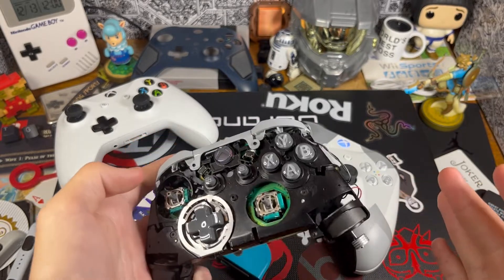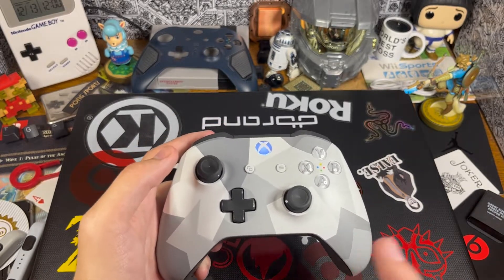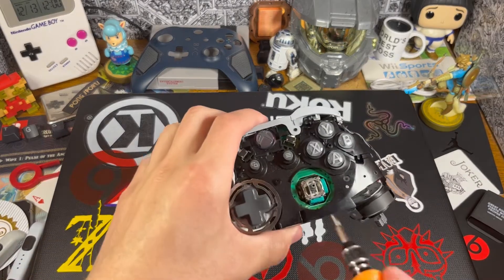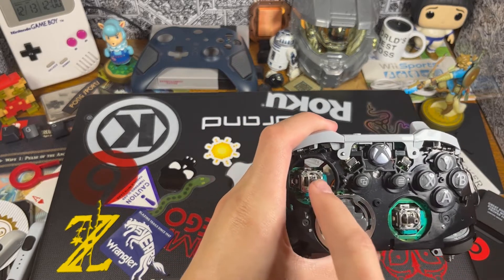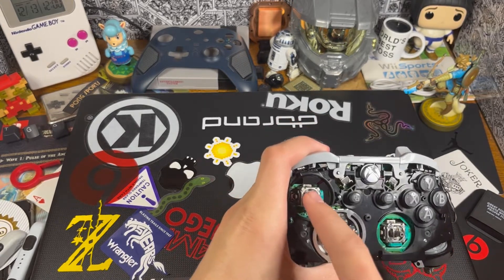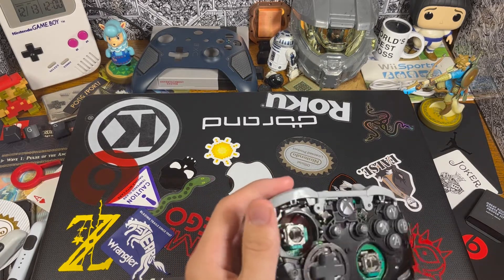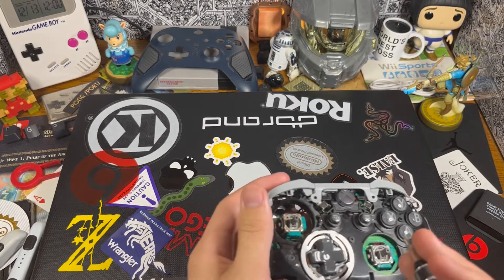Let's start with the internals of the controller and how to fix the drift. I'll be taking this controller apart and showing you the drift before and after to prove this method works. First, I want to start with an already torn-down Xbox One controller as a test subject. These green sensors on the bottom and right-hand side of the analog sticks are potentiometers. The bottom one records the x-axis — left and right — and the one to the right records the y-axis — up and down. Over time, the sensors may build up metal shavings from wear, causing drift or complete failure.